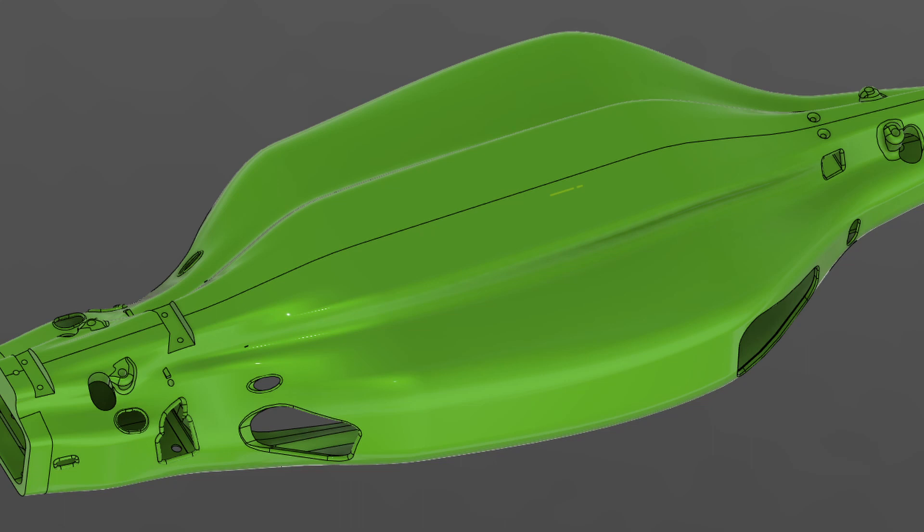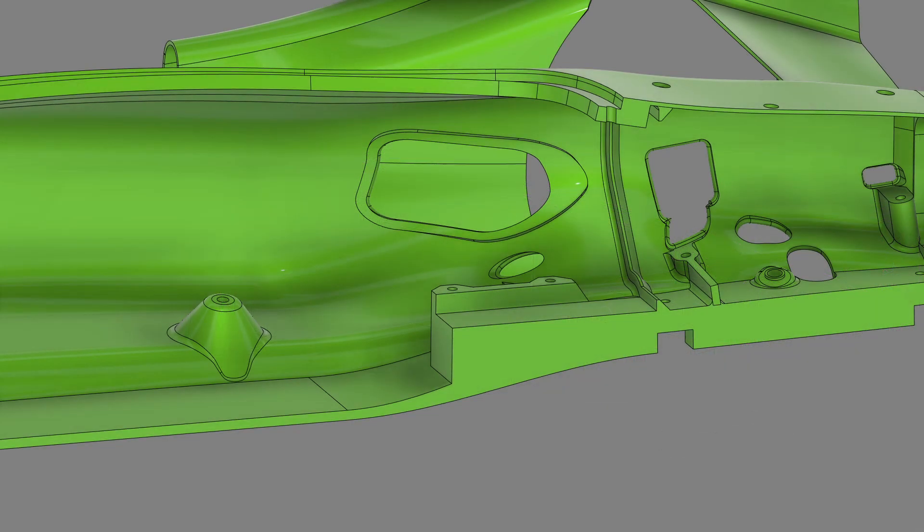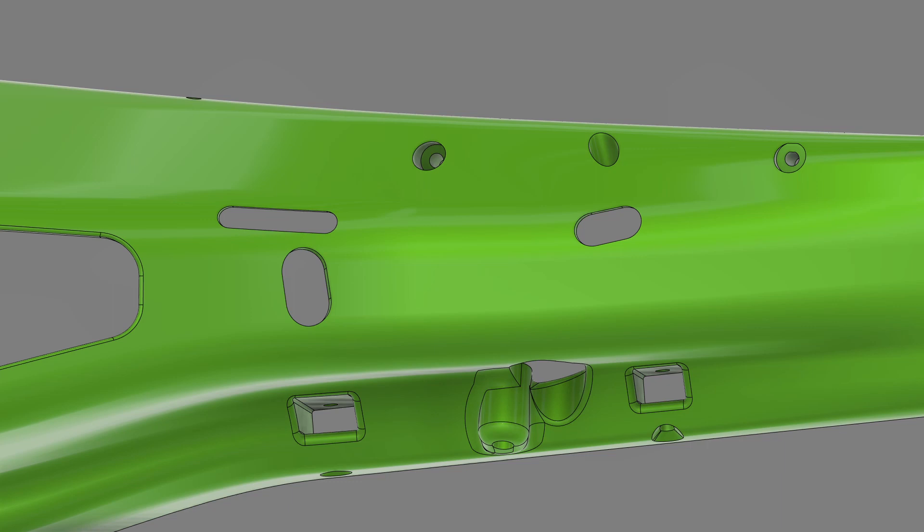A couple of unique features of the monocoque: first, there's a longitudinal rib structure that runs the entire length of the bottom of the monocoque, serving a few different purposes. It stiffens and strengthens the most stressed portion — very important given it's a 3D print, as I'm trying to add more layers so it can't separate there. Secondly, it allows the heaviest component, the battery, to sit as low as possible in the chassis and as close to the center as possible, which lowers the polar moments on the chassis so it can rotate easier. And lastly, the rib provides a thicker portion of the monocoque on which to design the mounts for the suspension and the rockers.